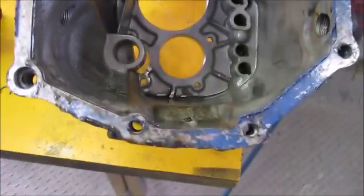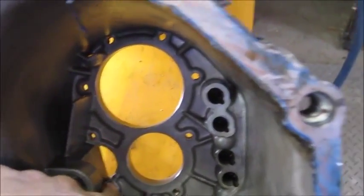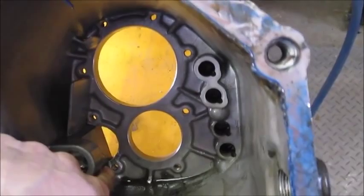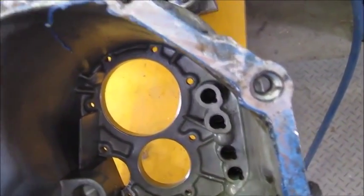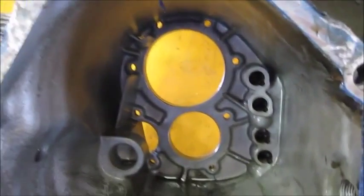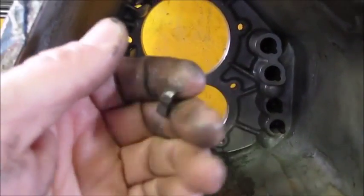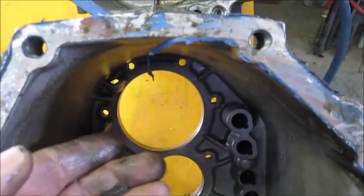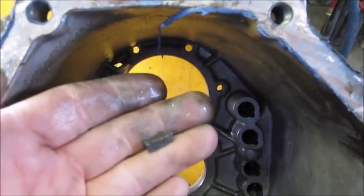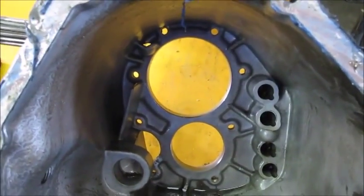Even once I pulled the cases off, you can see — I don't know if you can actually see it in the video — but there's some scoring that occurred right inside of the case housing where the gear and stuff was grinding. When I pulled the transmission apart, I found that a couple of the synchromesh keys were broken and laying inside of the case. I suspect these may have gotten towards the front of the case, were caught by the gears, and created some of the scoring.